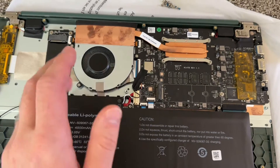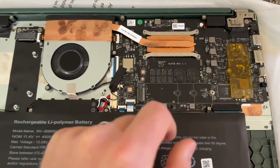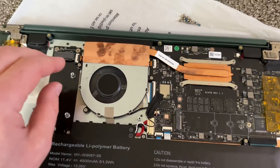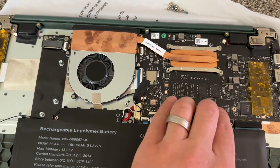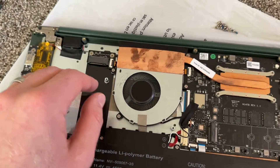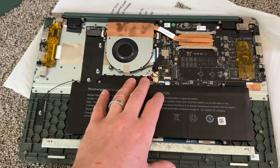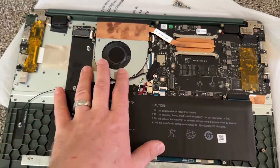I can conclude that you can safely put another SSD here. If you want something more involved, you can switch out the existing one, but I think it's a good idea to keep the 512GB just for Windows and programs and use the second slot just for your data. So if you reinstall Windows, you wipe the system drive and all your data stays on the second one. I wouldn't waste money investing further — it's a cheap computer, but fast for the money.